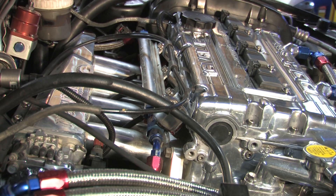You can tell by the way it was idling that one of my injectors doesn't seem to be firing. That can be caused by three different things. One would be a clogged injector, and it's probably the most likely. Two would be a bad injector or a burned out injector, and we can test for that - I'll show you how.